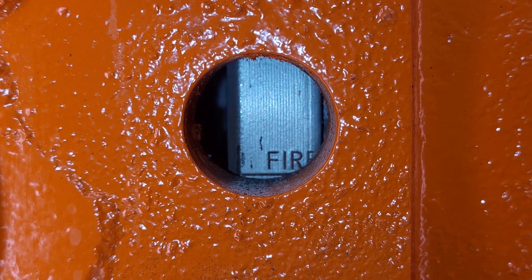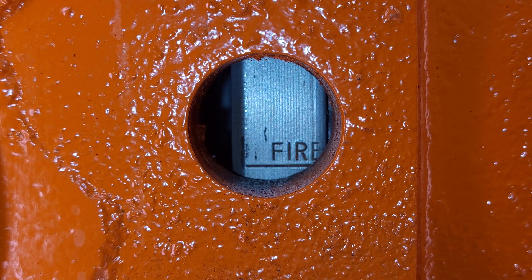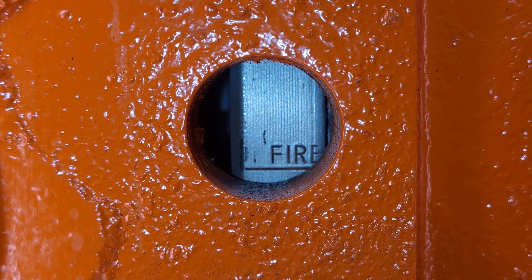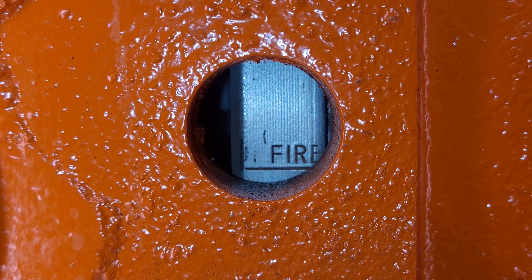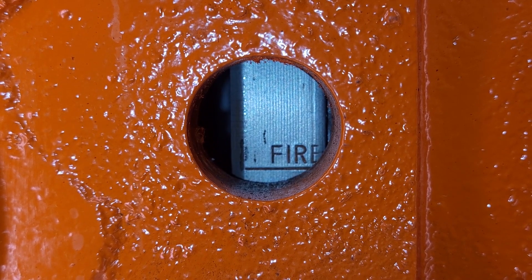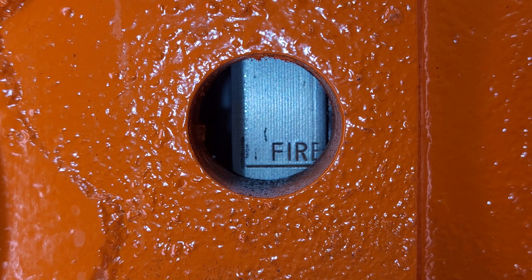There we go — so that mark that says 'fire': that is not necessarily where the magneto would be set at this point. That fire mark is 30 degrees before top dead center. So if you use a timing light while it's running above a few hundred RPM, when the magneto is no longer clicking, that is where it should fire. The mark we're looking for is the top dead center mark.